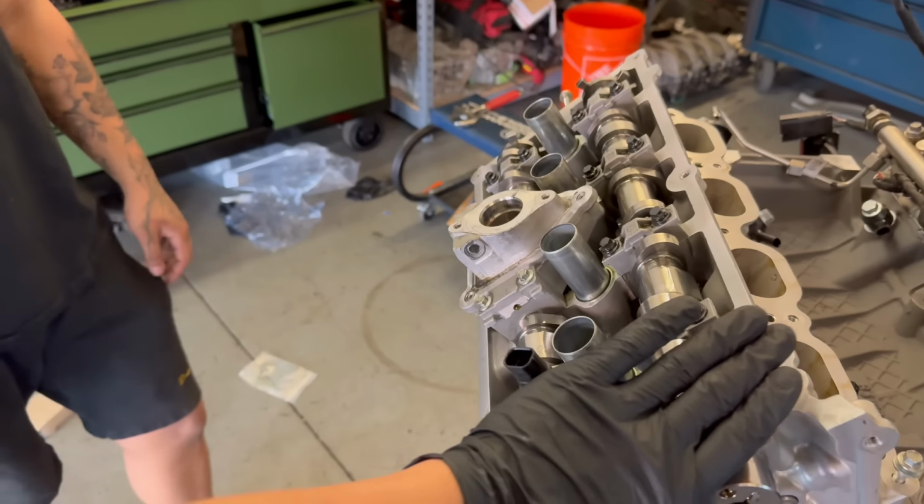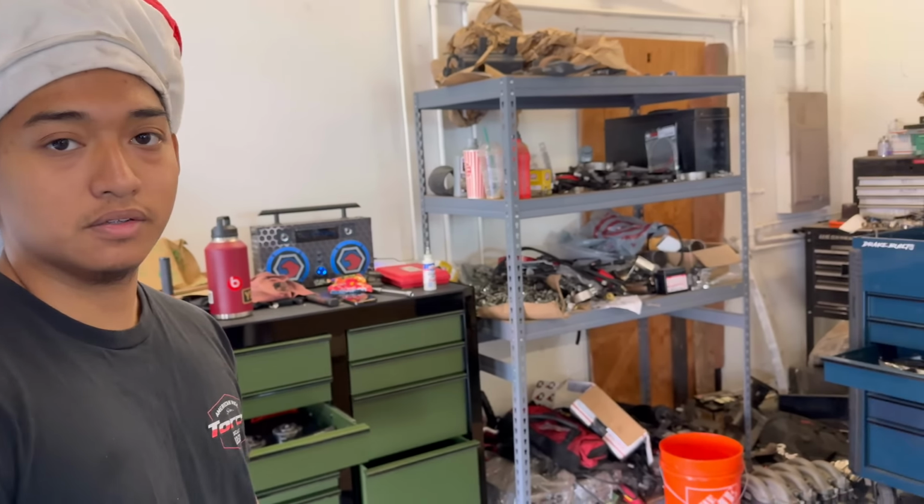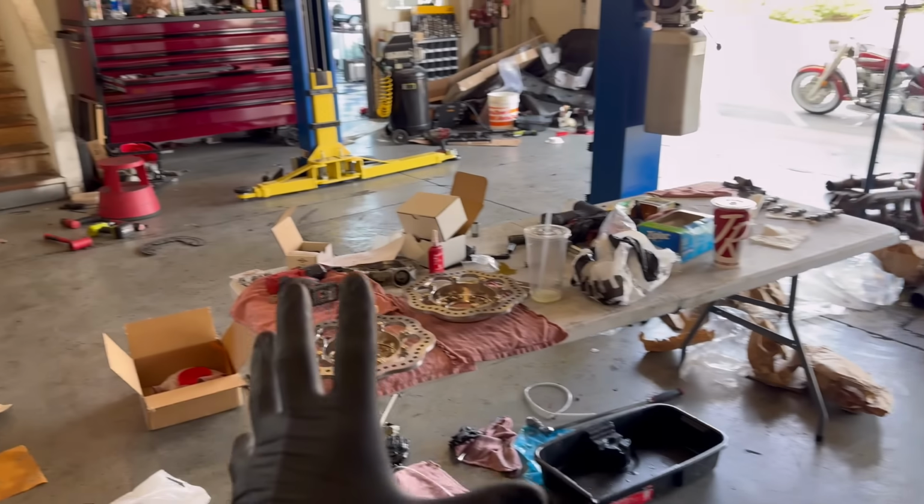Alt worked. Can't show any part numbers, of course. 90 inch-pounds. 53 in the sequence first, and then 90. That's ARPs. We go by torque specs.